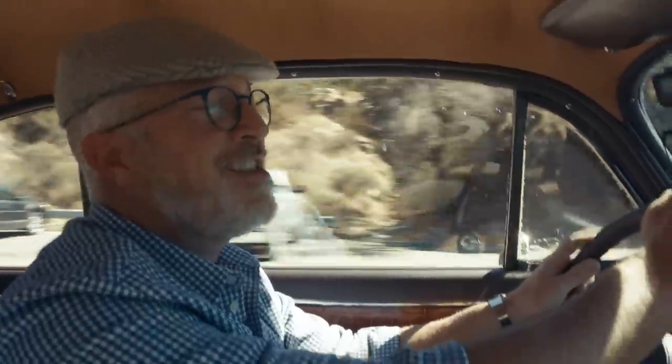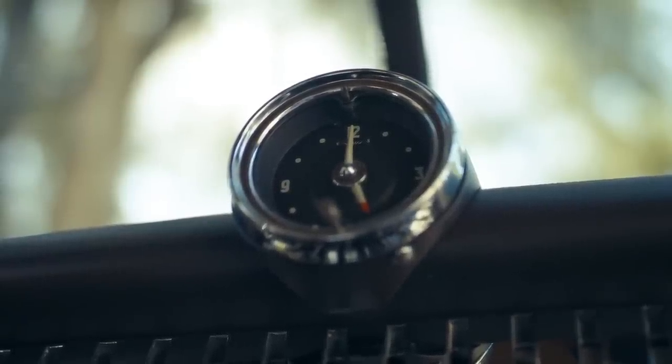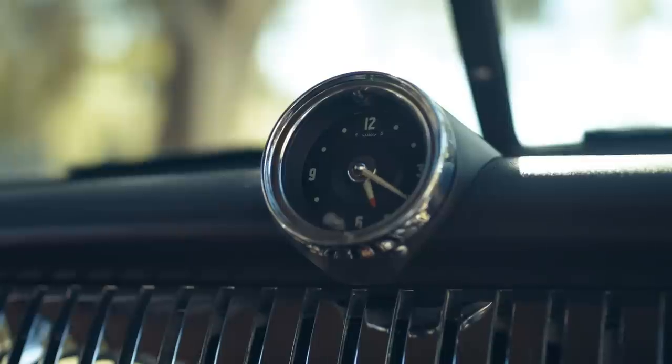The client really wanted a tachometer, and I often feel adding a tach is tacky, so we had a really fun idea. We turned the original accessory clock into a tach — it looks like a clock, but the hour hand, which I painted red on the tip, is your redline indicator, and the minute hand spins wildly when you're driving it like an idiot. It blends in so well that when I hopped back in the car recently, I noted 'the clock's acting really weird' before I remembered what we'd done.